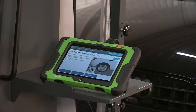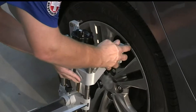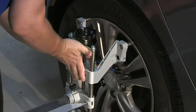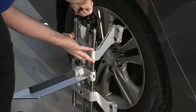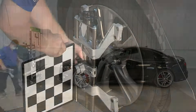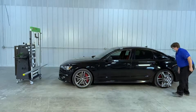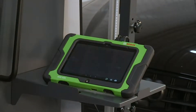Attaching wheel clamps and alignment markers, one on each of the left and right rear wheels. Place the grabbing hook at the top of the wheel. Don't forget to attach the bungee cords to secure and prevent the wheel clamps from falling off. Slowly tighten the wheel clamp and straighten the target so that it is perpendicular to the floor. Securely attach both wheel clamps with alignment markers to each of the rear wheels. Press continue to proceed to computer vision positioning.